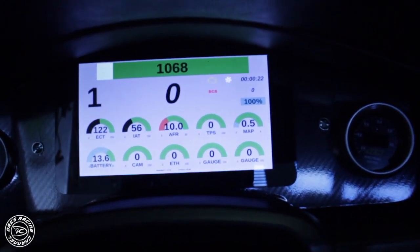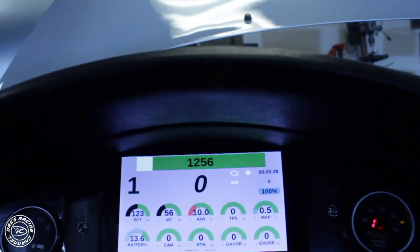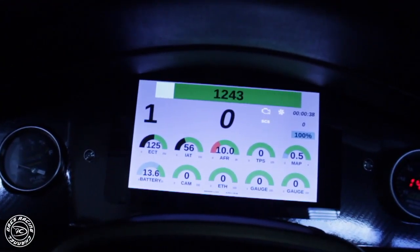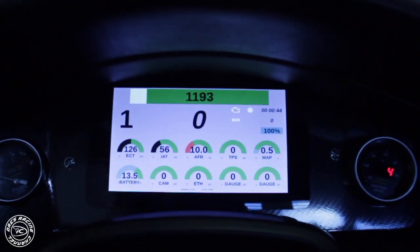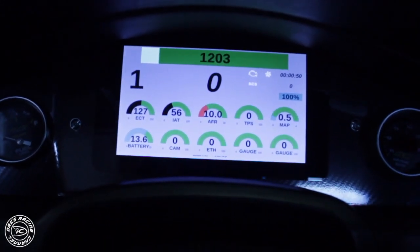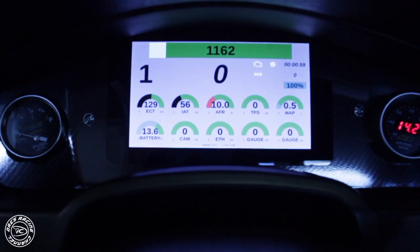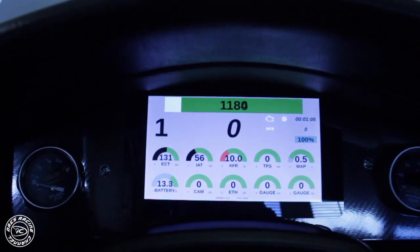You can see it's just a signal to show that it works right there. But the car is idling a lot better. Once I fixed that K-Tune throttle body, that was the issue — it was sticking. The throttle no longer sticks anymore and the car is idling good. So if you're having that issue with your throttle body, or if your car is fluctuating at idle — like between 1800 and 1900, sometimes 2000, just idling high — that's the issue if you have one of those K-Tune throttle bodies. Now the car just idles smooth.